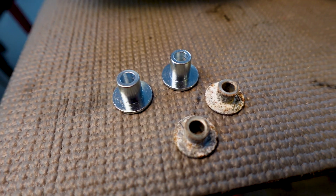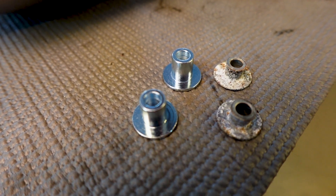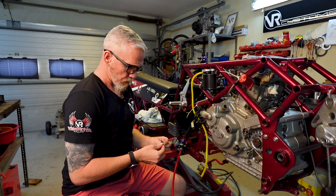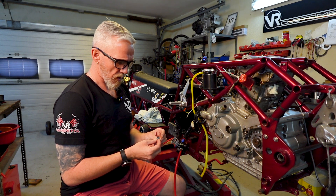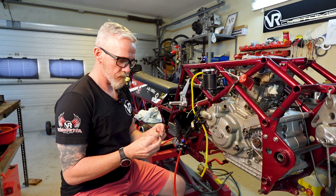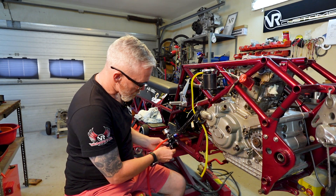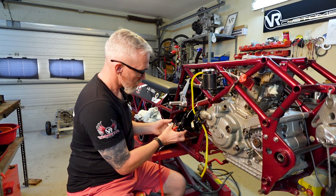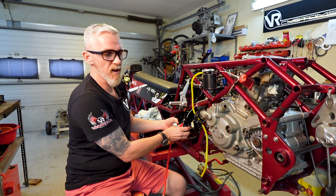I just can't put the old ones on — they're just too bad. We'll put the new ones on instead. These little top hats are actually designed for Ducati grommets that hold radiators and exhausts, and they're quite common on Ducatis. Not a Ducati part though — this was made in the UK. It's just a little top hat to stand off the mount, which is nice and powder coated now, because I didn't have time before and it got really nasty with salt.